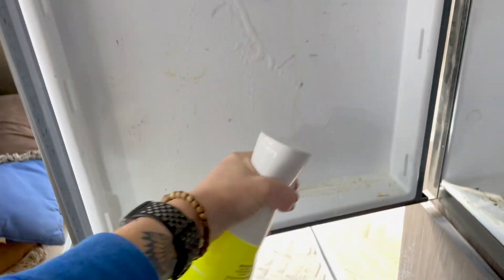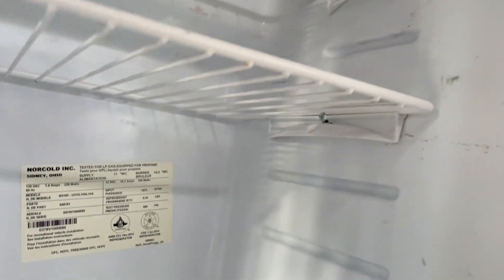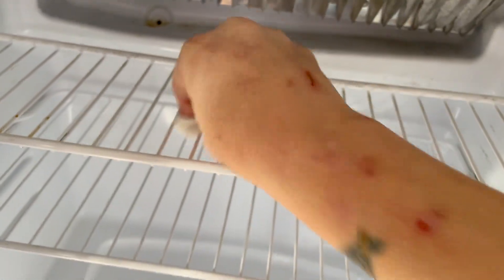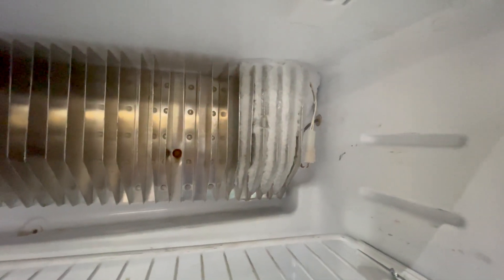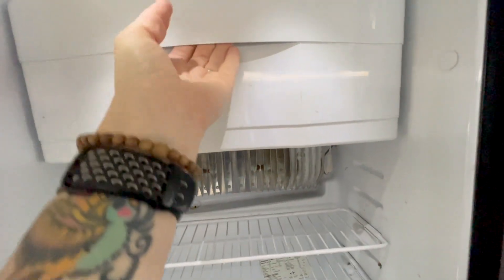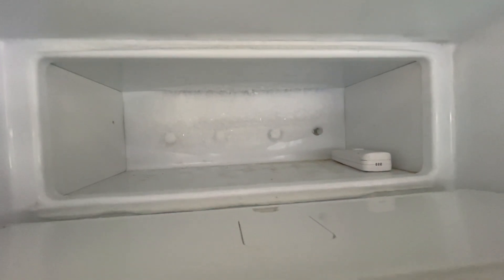I know some of you are going to say 'but Mandy, that's chemicals — why use it in your fridge?' I've used a lot of organic cleaners and I'm just not happy with them, so I use what I know. For the fridge, I take a nice wet rag, rinse it, and dry it. Honestly, never had a problem. If you have a Tab 400 fridge like me, you'll notice the racks are actually screwed in. Personally I'm too lazy to remove them, so I just wash them right in the fridge. Also, every once in a while, completely turn off your fridge and let it thaw out because ice will build up on the cold components in the back and in the freezer.